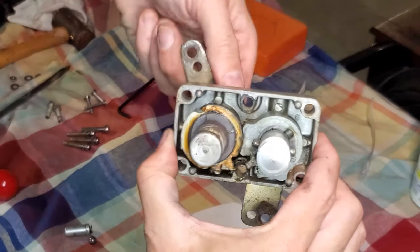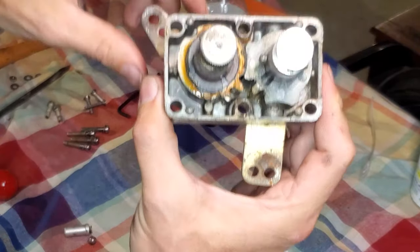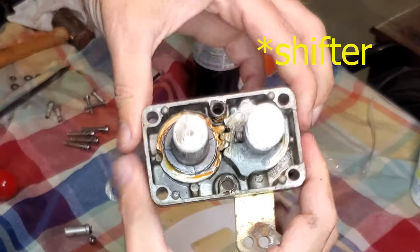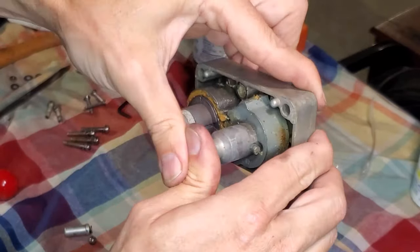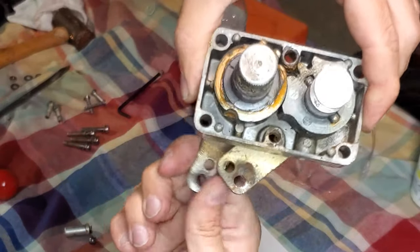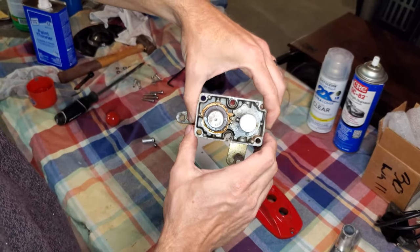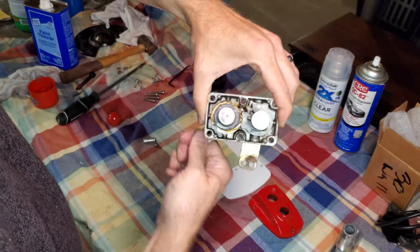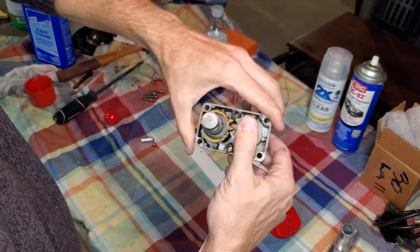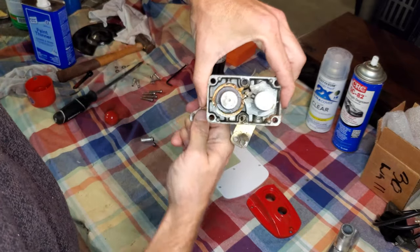That would be if you were pulling it out. And now when you spin your throttle, you see that that cam rotates freely without turning your throttle linkage. And then when you re-engage that button, ooh, yeah, that's tight. Now when you re-engage that button, you can see your shifter linkage is now engaged. And that's it. It literally is that simple. So, lever out, cam is allowed to spin freely on the shifter shaft; lock button engaged, yep, tight.